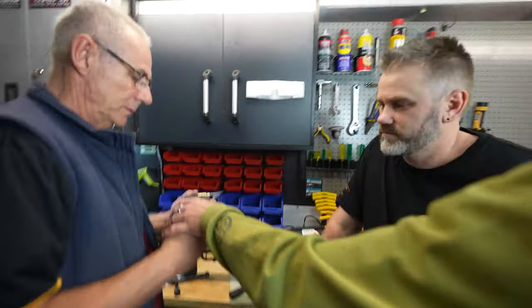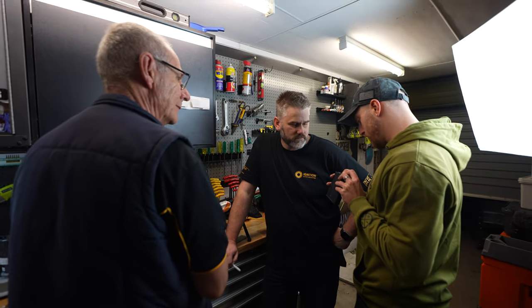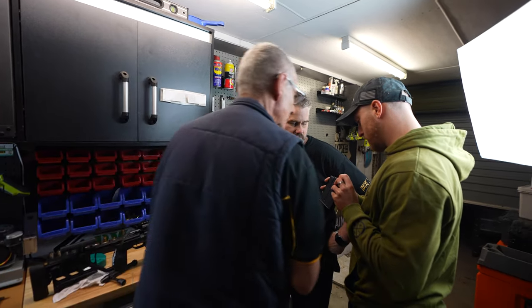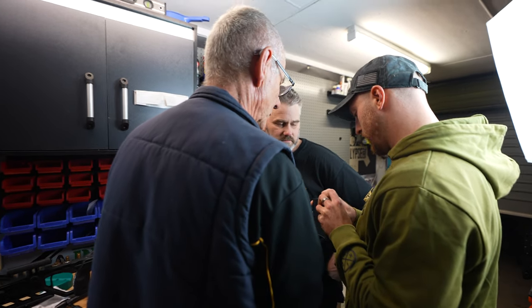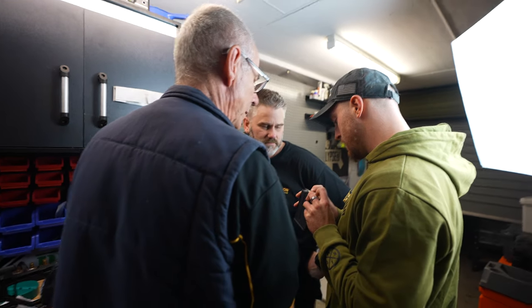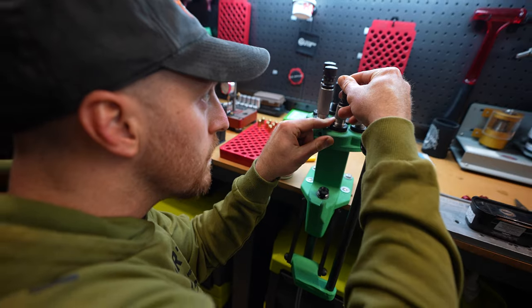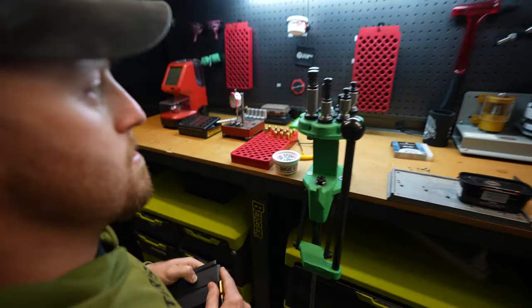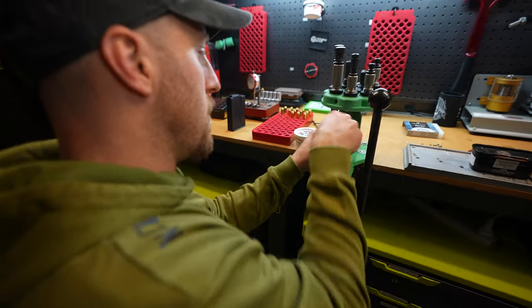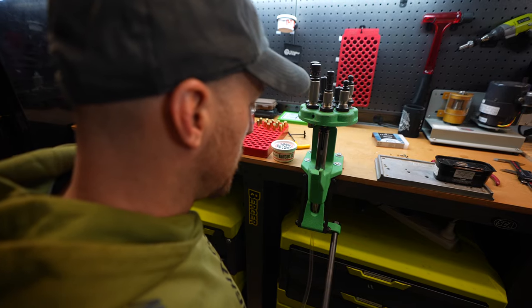Okay, perfect. You've got no binder plate in there, too. Correct. If you were running a binder plate, you'd be having to come out even more. Yeah, another 5 or 10 thou, eh? Mm-hmm. And 4, 15. So it'll be 75.15 millimetres. Start there.